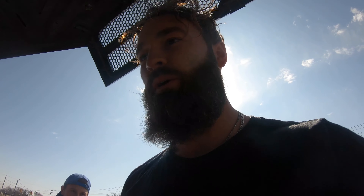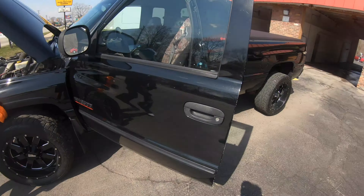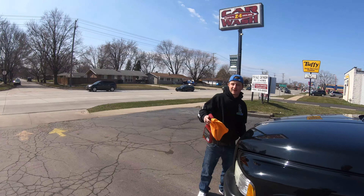I just got a lift pump too on this other Cummins — it's the Fleece in-tank lift pump. Pretty much that pump's in-tank, and I mainly went with that one because it comes with a new fuel gauge and mine was off. Driving my truck around prior to getting the Fleece, the throttle response was terrible — it felt like a complete slug. Now it seems like it was a power mod. It supports up to 800 horsepower.